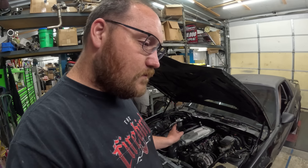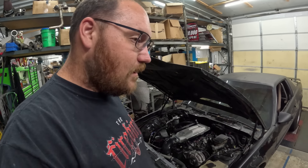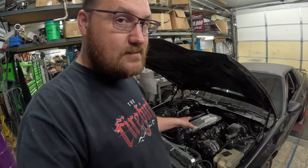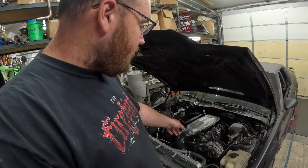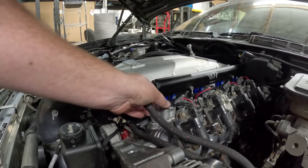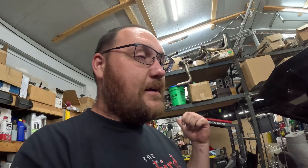What we got is a Muller Dart six-bolt block with 388 cubic inches — that's the four and an eighth inch bore with a stock-type stroke. All goodies down there. We got a hydraulic roller camshaft in this one, and we got the Brodix BR7 heads. We've also got BTR Trinity LS7 heads with a 16-injector intake which is a common rail. We're only running one set of injectors currently because we do have a Holley Terminator in this. I haven't put my Dominator in there — I do have a Dominator for this car, actually a lightweight Dominator I'm gonna put in the race car.